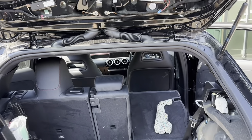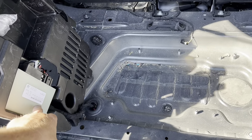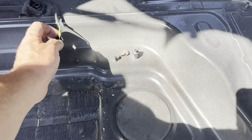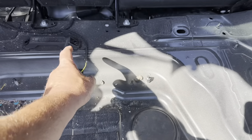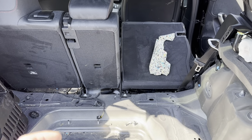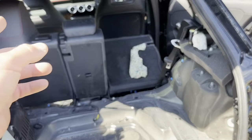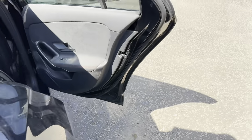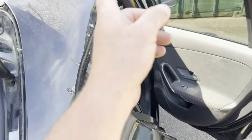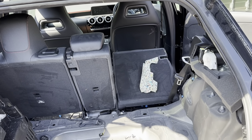I'll continue doing as much as I can. It's funny - there's computers in the back of this one. There's a sensor there and yellow wires - is that the seat belt airbag sensor? You just don't know if that took a bit of a knock, if that's what caused those rear seat belts to go off. None of the other seat belts have gone off - the front ones are all fine. I guess when we plug it in we'll know, but it's coming up on the dash as a rear seat belt fault, nothing else.